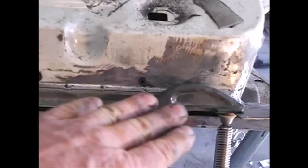It'll act like a heat sink again, and I won't blow through the dang butt weld and stuff. And I only do that on the ends where I can't get a flange underneath it, you know. So I don't know, this is really a pain. Like I said, I'll spend more time on 4 doors than I will on all the rest of the car, but it'll be nice. That's how I'm seeing it. It's going to be a real nice deal when I'm done. Anyways, I'll show you this all when I get it done. We'll start getting the skin on and go from there.